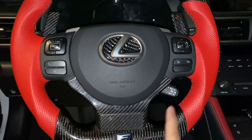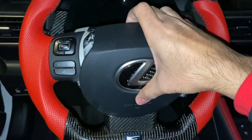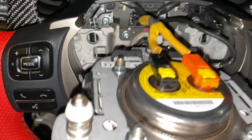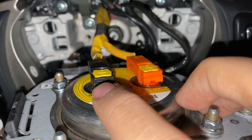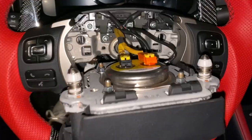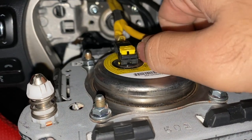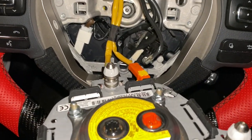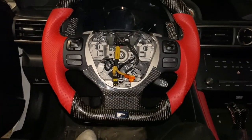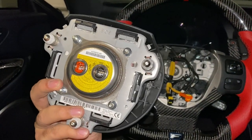So after you've got the pins pushed from this side and this side, you should just be able to pull out the airbag. Be careful — it's kind of heavy and there's some wires attached right here on the back. Just put it down gently. Then use a flathead to pop this up, pop this up, and then disconnect this little guy right here. Make sure these yellow things are popped up all the way, and then you just gotta kind of wiggle them off. Once you get those three wires disconnected, you should just be able to take the airbag fully off the steering wheel and be left with this. And then this is what we're replacing, but we need to transfer over this entire airbag unit first.